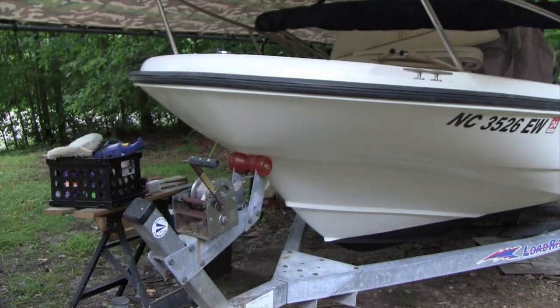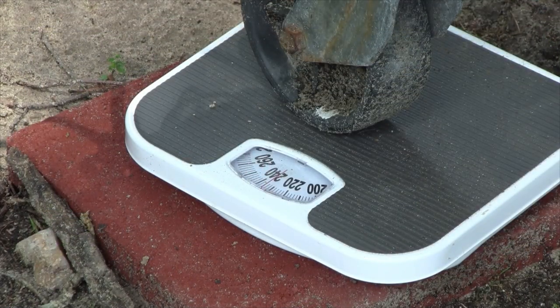One of my great concerns was the tongue weight. Moving the boat back 5 inches — which is ultimately what we ended up doing — should decrease the tongue weight, but we didn't know by how much. I weighed the tongue weight before we started: it was 265 pounds. Now it's sitting at 230 pounds — we lost 35 pounds of tongue weight. I think the tongue may have been somewhat heavy to start with, so a tongue weight of 230 pounds should be sufficient to tow this boat correctly. A few more minor things and we'll take the boat down to the lake for trial runs. I hope this video has been helpful — hit share and like, don't forget to subscribe, hit the bell button, and leave some comments.